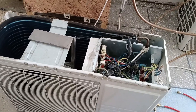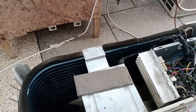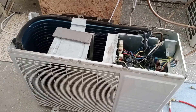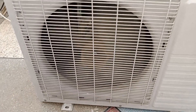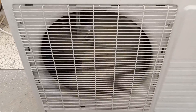This unit will have one of the problems I described, since it is not possible for the unit to have all the faults at once. Multiple faults are possible if the unit has not been serviced for a long time. Now let me explain the fault in this unit due to which the P6 error is shown. The unit's fan motor has started to work as I have powered on the unit again. It started at a reasonable speed, but suddenly it started to operate slowly, and after some time it stops eventually.